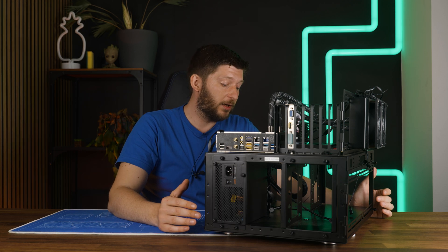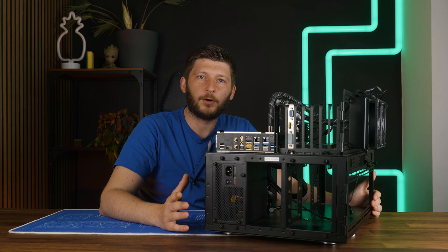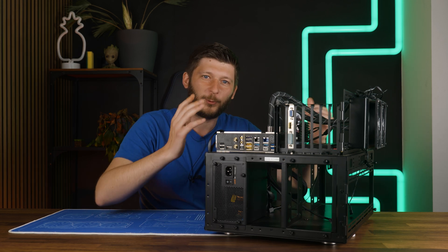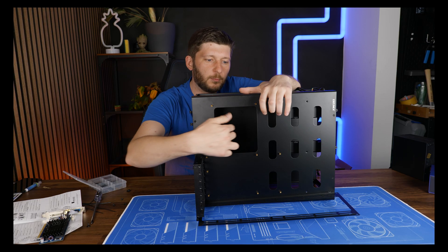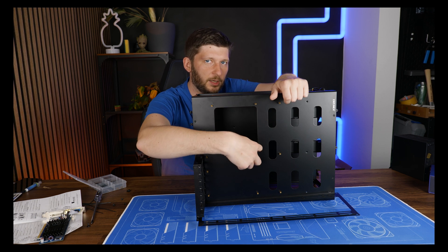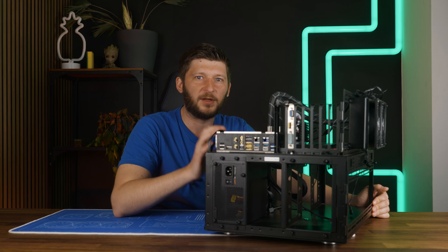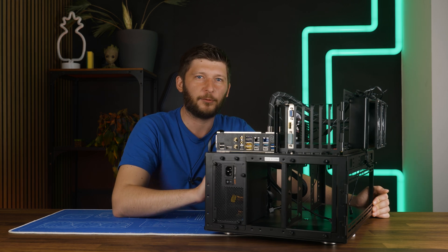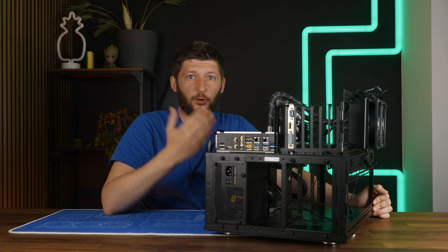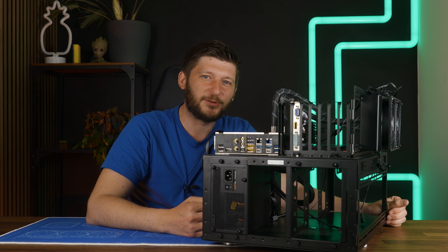What I do care about is removing and installing motherboard backplates without the need to reinstall the whole motherboard. For LGA 1700, the backplates will not come off — the hole underneath the motherboard is just not big enough. That was very unfortunate for us, because we bought this case for the very specific intention to install cooler after cooler after cooler, hence removing the backplate over and over again. But to be honest, we did solve the issue with some good old domestic violence.